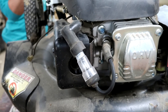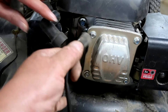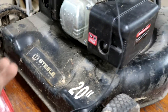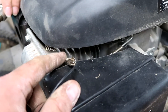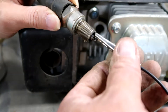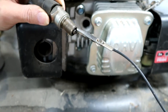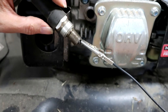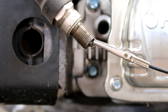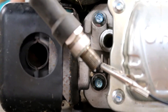So now we're just gonna clean up the spark plug. If you want to test your spark and you don't have one of those, here's an alternate method: use a jumper cable and clip one end to the ground — the frame of the engine — and the other end to the bottom side of the spark plug. When you pull, you'll see a spark come across that. A little jumpy, but I can see the spark — so the spark plug is good.